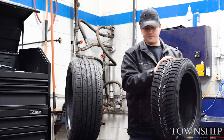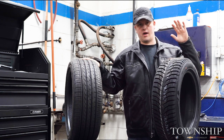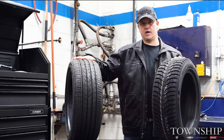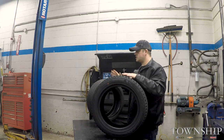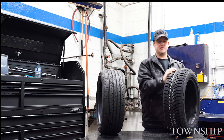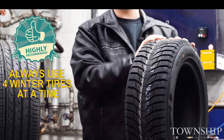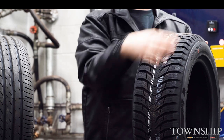So that's the main differences between all-season and winter tires. Winter tires obviously offer more traction in winter driving but aren't as good in summer. You can also buy strictly summer tires, which are an even bigger step above all-seasons for summer driving — grippier, softer compound, more rubber contact. The all-season doesn't do anything great, but does everything decently enough. Another thing to consider: years ago people put two winter tires on the front or back and ran two all-seasons. Tire companies, insurance companies, and technicians all recommend doing four tires if you go with winters, keeping the same tread pattern on all four for the best stability.